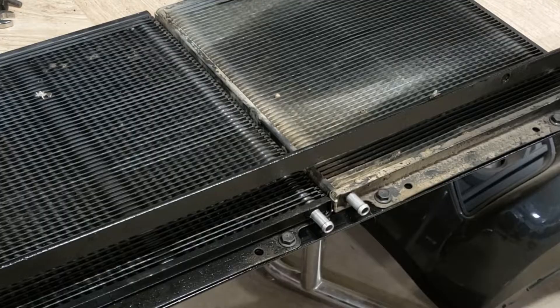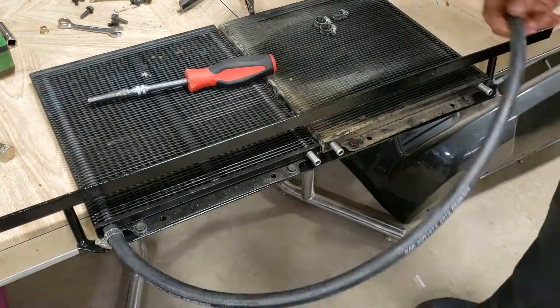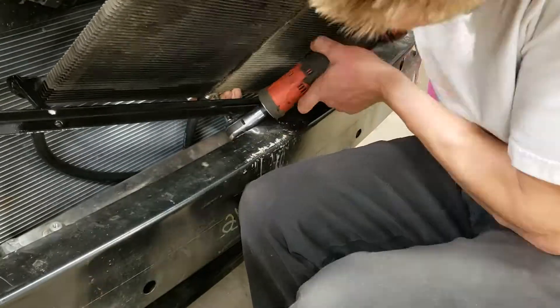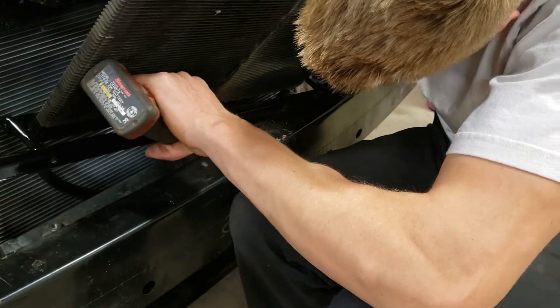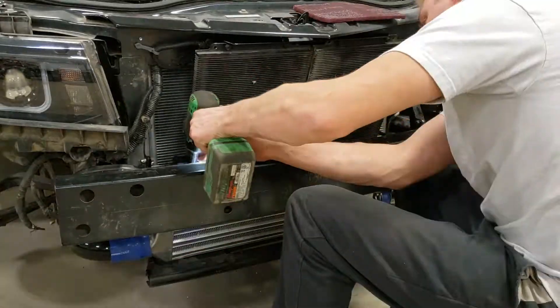So the top mount needs to go on first, and then you take the intercooler mount off — well it's already off because I painted it. Mount the coolers to the intercooler mount, and then I tied them together because they're connected in series. Then you can slip it into the car, attach the hoses that go down to the transmission, and then you can tie the coolers to that top mount we already put on. The bottom mount will get reattached to the intercooler and to the two holes we used on the core support.